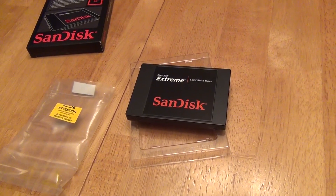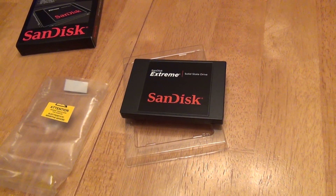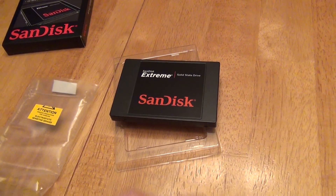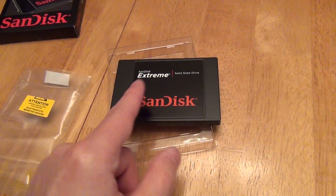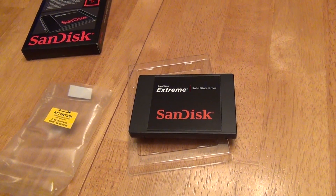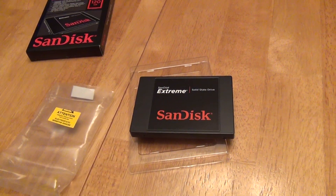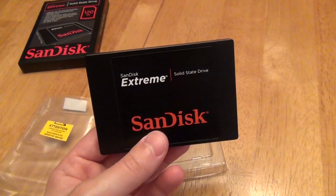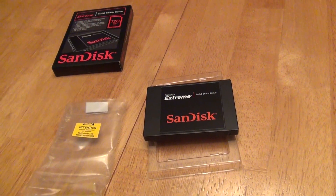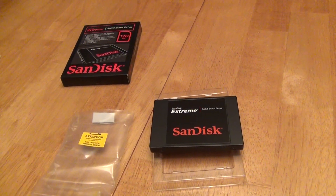Video is going to have one byte after the next, all lined up and can be read really well off a traditional drive. Whereas many small files — like when you're loading Windows, or if you're a developer with Java source files and class files all over the place — those are suited really well to the SSD. Put all your program files on the solid state drive, then for large files, just buy a 2 terabyte hard disk drive or 500 gigabyte for a laptop as your secondary. Without any software included, I was rather dissatisfied with the upgrade experience, but save yourself the heartache — I'm now recommending the Apricorn EZ Upgrade.